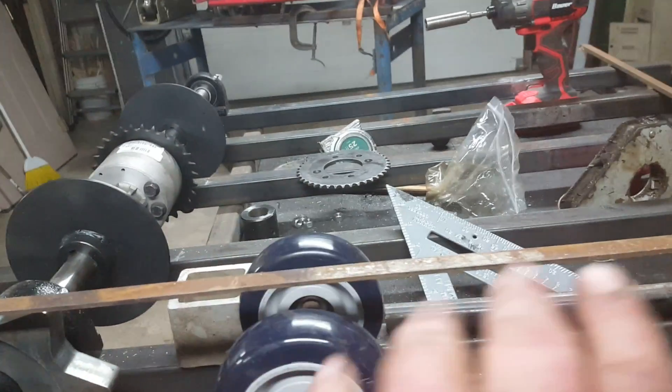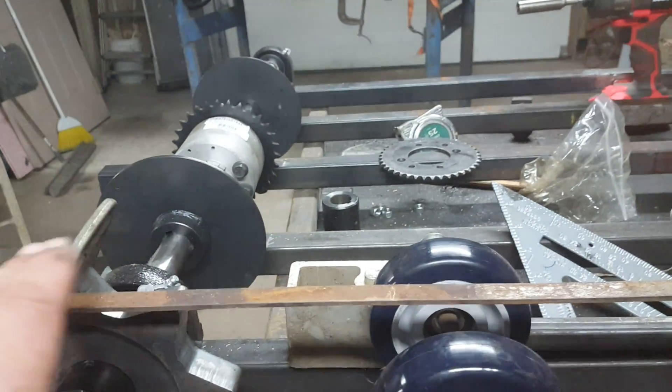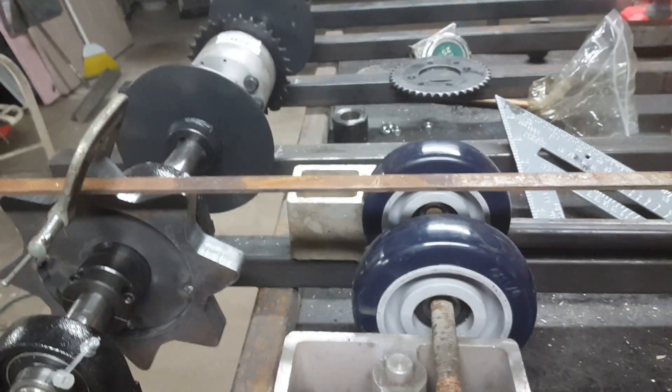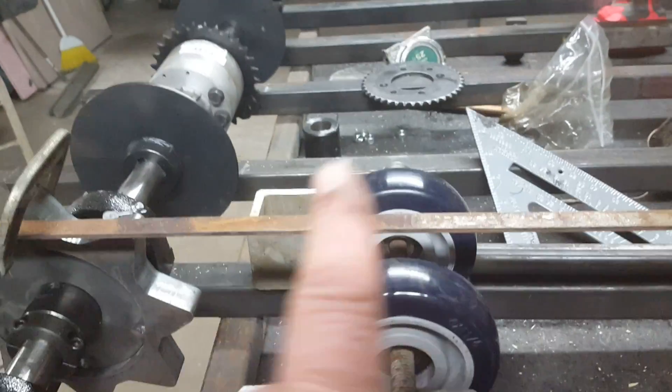My other track vehicle I had five-inch sprockets and I had them way up higher because when I first got that first track, it just didn't seem to bend real good. And I just didn't feel like cranking the adjuster way out. So we had a big hump in there. But with this one, I learned that you can really stretch the tracks out, and I'm going to run it perfectly flat.